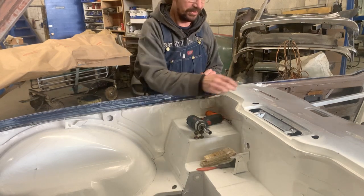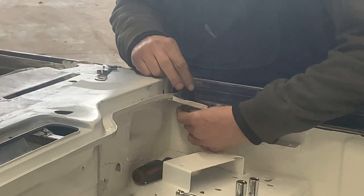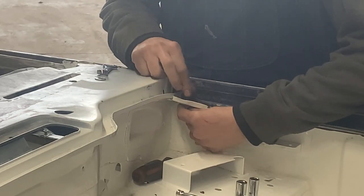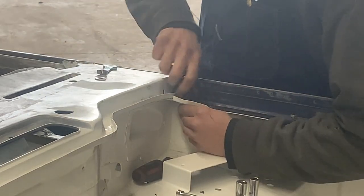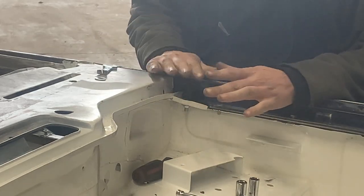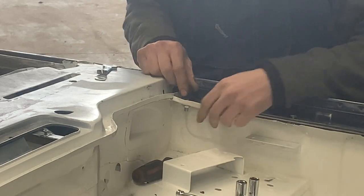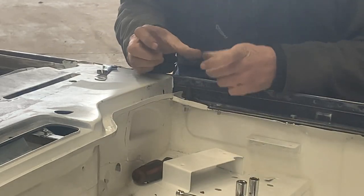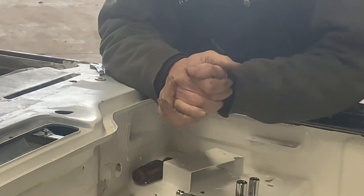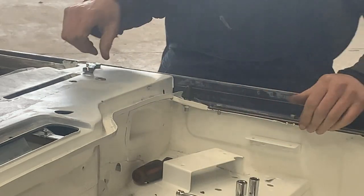We're gonna use this to align our bonnet. These are very important parts of the alignment — not only do they determine how high and low the bonnet is going to be, but they also determine how left and right it is going to be, or at least they help it stay where we want it. The hole where they go is pretty big and you can align it in all directions. If they were only controlling the height they would be flat, but they have this conic shape so they can go into the hole on the bonnet and fix it in place, because these hinges are not keeping the bonnet very solid in the left-right direction.